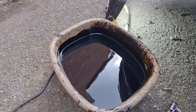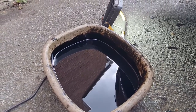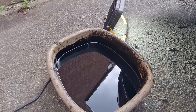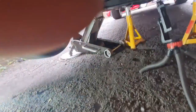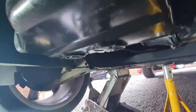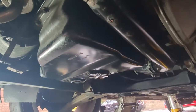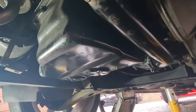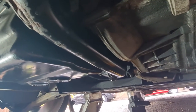That's all drained out. As you can see, that is pretty black. Diesels always are when you drain the oil, but especially so if you've put the flushing fluid in like I have. I've got the sump plug put back up — that is a main thing you need to remember. I've cleaned the bottom of the sump and everything else under there so it's all nice and shiny again. Now we are going to go topside and start doing the filters. Let's carry on.